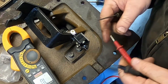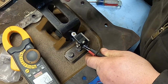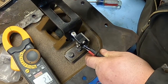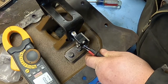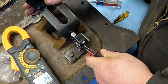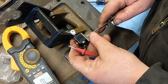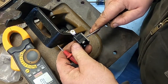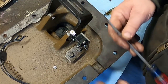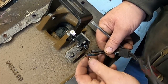A lot of guys just twist the two wires together — I am not recommending that. I like to have stuff working, especially safety stuff. The only time juice goes through this is when you're turning the key to crank it over, and it doesn't matter which one — it just completes the circuit, so either wire.